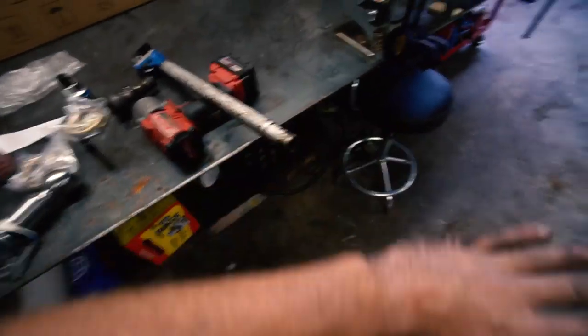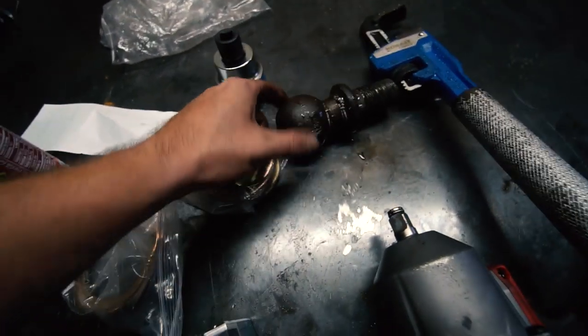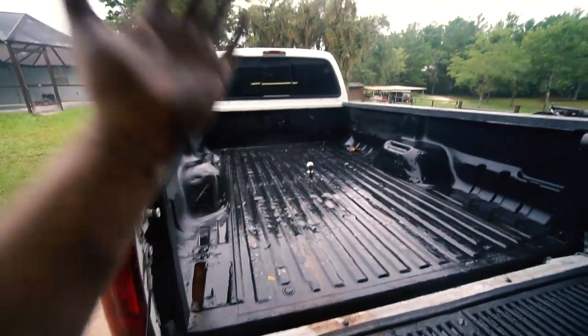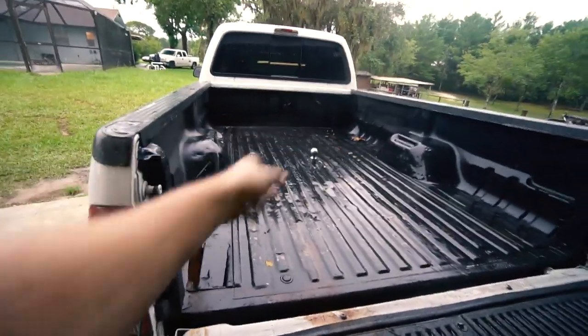It took pipe wrench plus a full jack handle with the other piece on. I tried getting it from underneath but couldn't get the handle on the nut at a good angle. So I did it on the ball on top. Got a really good bite there — you can see the teeth marks. Me and Ben with four feet of leverage, everything we had, me pushing and him pulling, to get that thing to finally crack. Our old hitch ball is out, new hitch ball is in. It looks sick in there — I know it's going to even out the trailer and now we can actually hook up the trailer without grinding into the bed. Just knowing it was grinding while I was test driving made me super anxious. We're getting closer to being able to tow the trailer and see what it's really like.